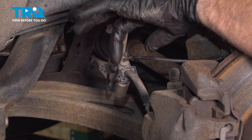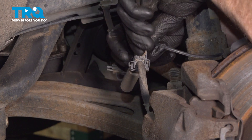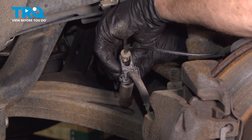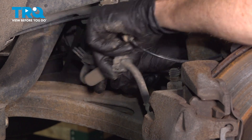Now we can make our way along the backside. We'll be looking for our brake flex hose and ABS wire — it's always a good idea to go ahead and separate these two. On the brake flex hose, they have plastic clips. You can just separate those two locking ears and slide it right out of position. We just want to make sure we have plenty of slack from both of these areas.